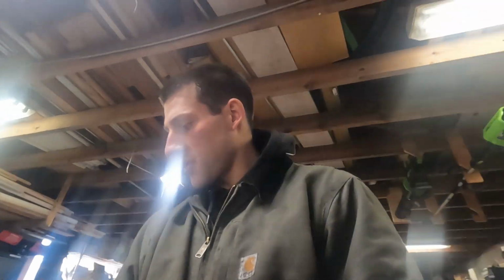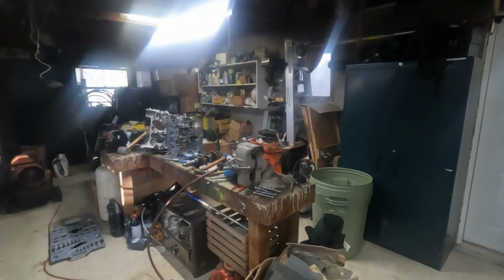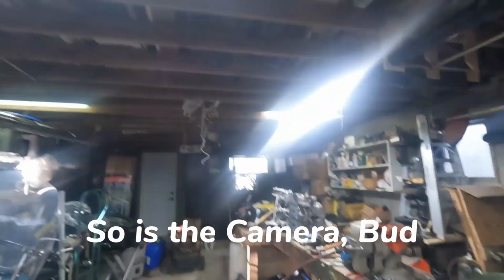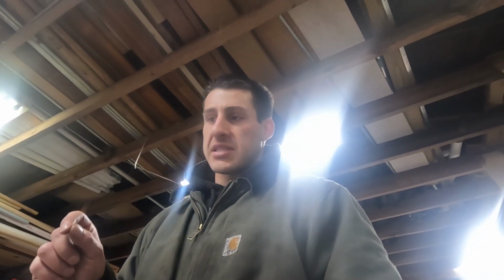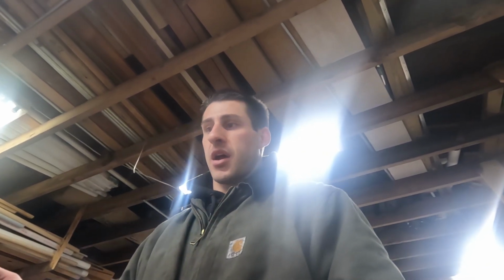So the next thing I want to do as part of this pre-assembly checklist is inspect these hydraulic lifters. There's 8 of them. We tested 1 through 8 just by pushing down with, I think, the back end of a screwdriver onto the workbench over there. Man, that's messy. I gotta clean that up. Some of them gave no resistance. They went down all the way, and some of them gave very, very firm resistance. And there was so much corrosion.